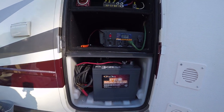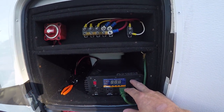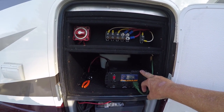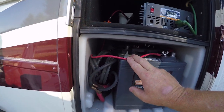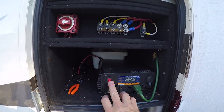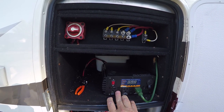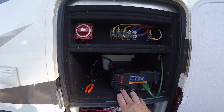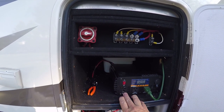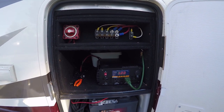What I've also done is I have this Sunforce Pro Series 1000-watt inverter that I'm going to use inside the coach. I come off the batteries down here, run it up through and back into this. Now all I have to do is — if I need power inside — because all your plugins in there will not work unless they're DC plugins, and everything you plug in there is not going to work unless you're hooked to a generator or have some other means to power those 120-volt outlets.